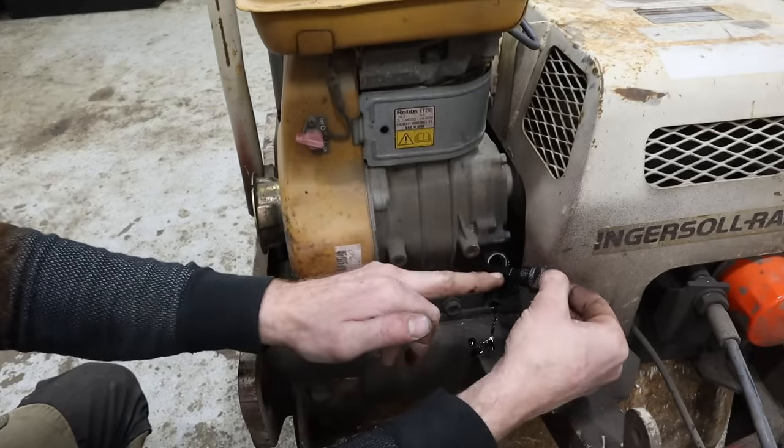So I went to the hydraulic shop, and wouldn't you know, the only line they had that will work is another chunk of air brake line, same as what I already made that first one out of. So we'll go ahead and throw this in there and try it. I don't know where to get braided tubing, it's like 1/4 inch ID, maybe 3/8 inch OD. This has got to be low pressure. I mean, that hydraulic pump is not making a ton. So we'll reuse these two fittings.